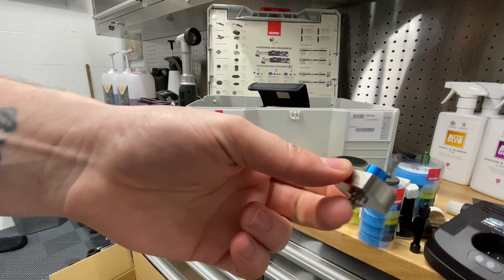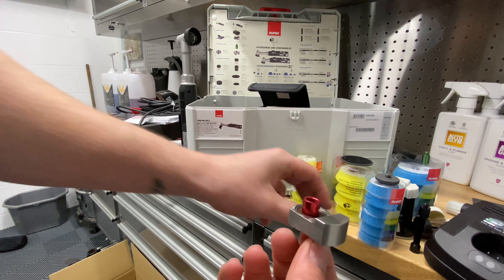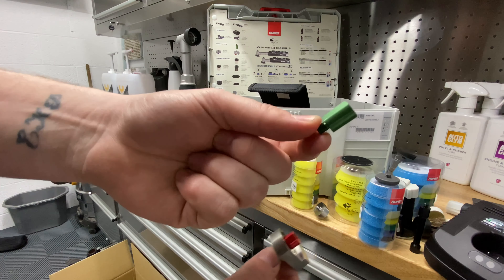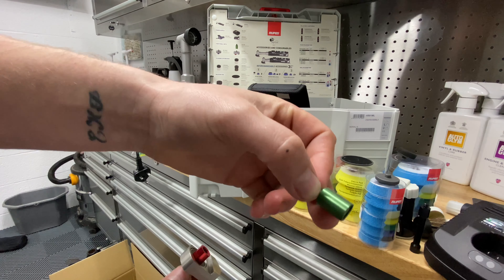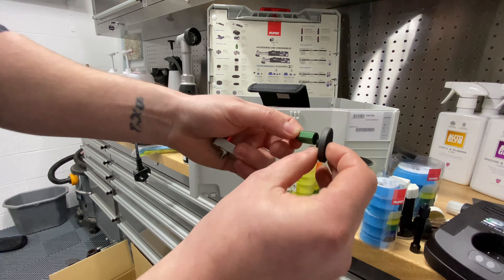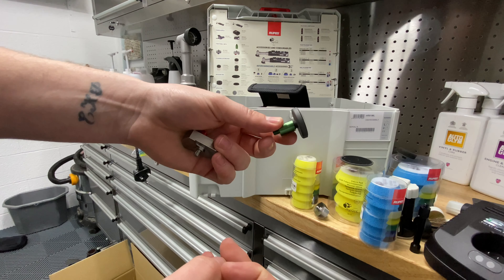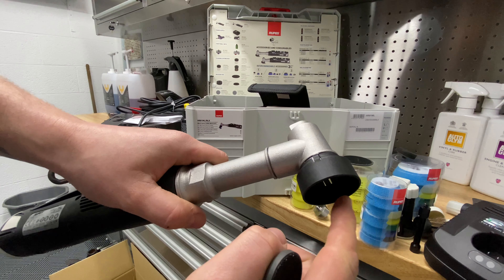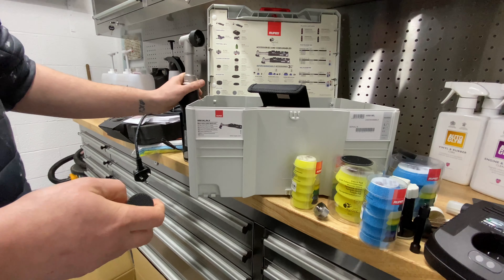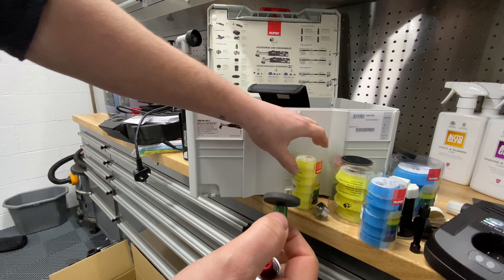You've then got a large throw and a small throw attachment. The small — I think it's 3mm throw — random orbital attachment is really only useful for wet sanding; a common mistake I've read about is people trying to use it for polishing and it doesn't give you a lot of cut. You've then got the 12mm throw attachment for random orbital mode. The 12mm attachment can only be used — intentionally by Rupes — with the smaller backing plate and the smaller 40mm pads, while the others are 70mm. That's so you don't put unnecessary stress on the machine, which is why there's a protective shroud that will only accept the smaller plate.